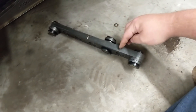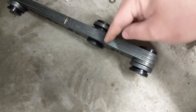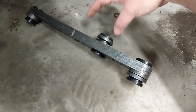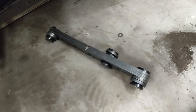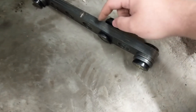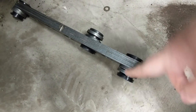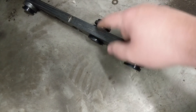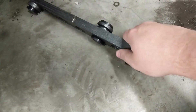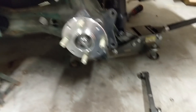Right now the way I've got it laid out, it's still rubbing the RTA. I've got three layers of quarter inch each — this outer one either needs to be cut around here and moved to the other side to shift the coilover over another quarter inch, or I just remove this whole piece and add two more spacers to the other side. That would move everything over a quarter inch and then it would bolt up fine.